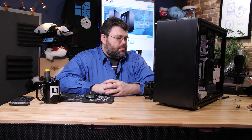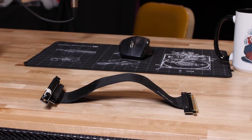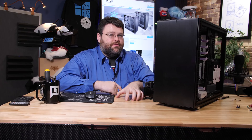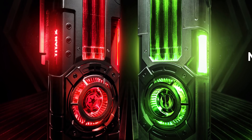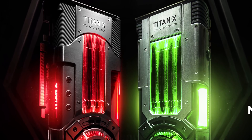The shroud in the bottom is non-removable but it is vented, so you get some airflow through that. It also has vertical expansion slots, so you can install your graphics card vertically. There is an optional PCI Express 3.0 breakout kit with mounting holes on the power supply shroud — we tested the PCI Express 3.0 speeds and it worked great. If you're going to get one of these from the aftermarket, be careful of quality — cheap imports are likely PCI Express 2.0. In general, vertically mounting your card can make acoustics and thermals a little worse depending on whether it's blower-style or fan-style. But if you want to show off a high-end card like an NVIDIA Star Wars edition, vertical GPU mounting might be for you.